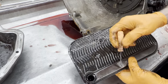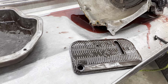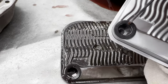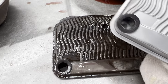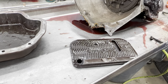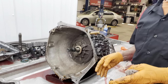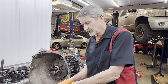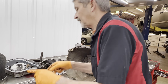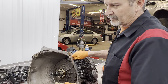You can see it's got a regular paper filter and it is just totally stopped up. The screen filter — if you look down into the neck you can physically see the screen. It doesn't catch as many particles, but when you're running a high volume pump you don't want that pump to have any problems sucking fluid through the filter. These paper filters brand new will not supply a trans brake tranny. They'll trap all the trash, stop up, and burn the tranny up is what usually happens.